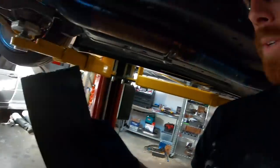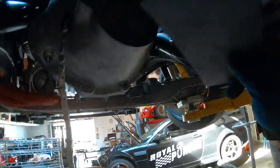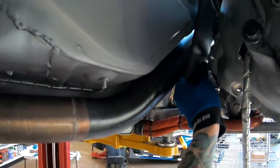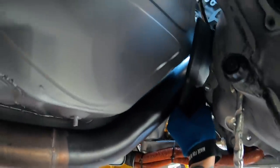It feels freaking perfect — time to sit on the ground and rip a skid. Alright, here's how you build a scatter shield for an FD car. We've got some four-by-quarter-inch plate, and per the rules it has to protrude an inch past the rotating assembly, so this is plenty wide enough to cover everything. This is going to sit up underneath and we're basically building a giant stop sign around the rotating assembly — come down with a little flat plate and back up and around. The tightest spot is right here, and that's why I had to move those O2 sensors. We're going to flange off of that piece, get it up against the transmission tunnel, and that's where it's going to bolt in.